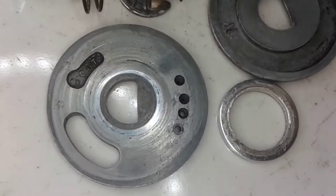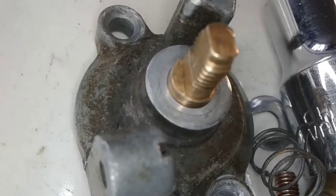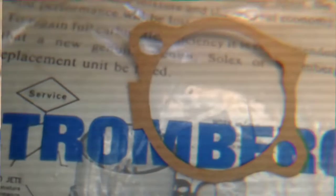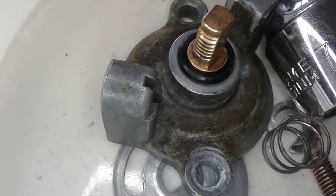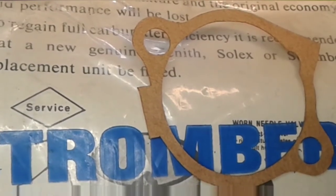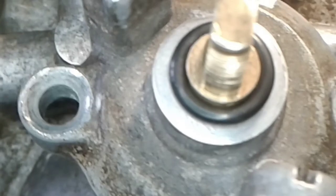After the work we have to wash off all remnants of the toothpaste. Some repair kits have a cardboard spacer like this. It seems to me that it is not necessary to use an additional rubber ring, because it makes the mechanism difficult to work. The gasket is very good, but the most important thing is the smooth surfaces that are in contact. I do not recommend using a rubber ring — cardboard gasket is available in many carburetor kits. I used the rubber ring and didn't like it; it doesn't work well with gasoline.